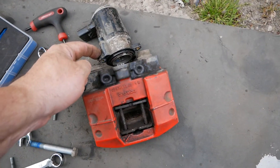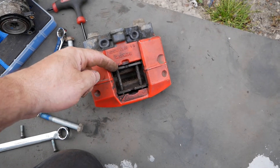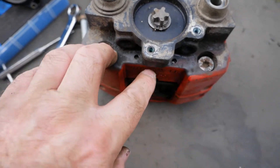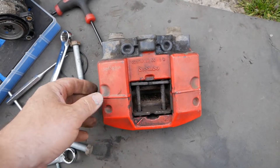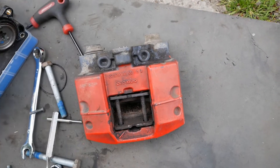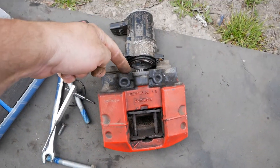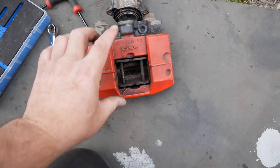The other thing I tried was releasing the pins which hold your two little brake pads in. You knock those out from the back through that little hole there and that little hole there, pushing them out from the back so they come out the front. In this case they were absolutely solid. I could not get those out, and having the actuator still on does hamper it a little. I only had a few inches of depth to work with.